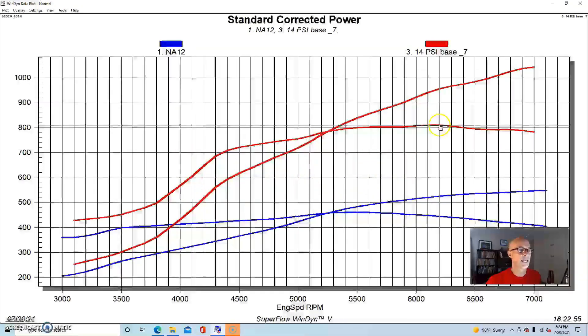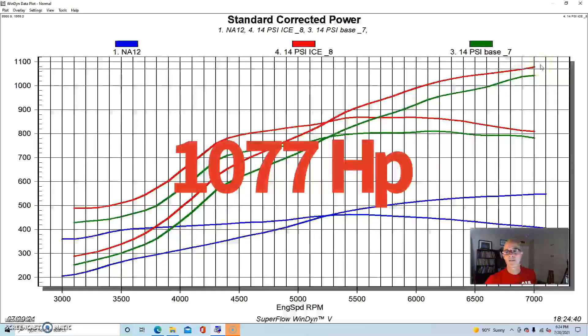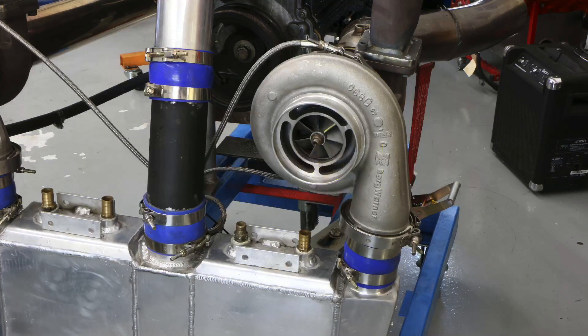Running at 14 pounds, our combination produced 1,042 horsepower and 810 foot-pounds of torque. When we replaced the 78-degree ambient dyno water with 32-degree ice water, the power picked up pretty dramatically — peak power was 1,077 horsepower, with gains as high as 70 horsepower. There were no ECU adjustments: air-fuel was exactly the same, timing was exactly the same. The only change was the charge temperature — but we also saw a change in boost pressure. Why did the boost pressure change? That's the big question.